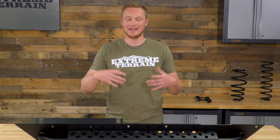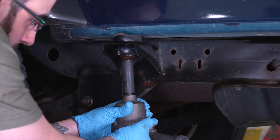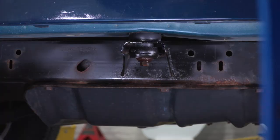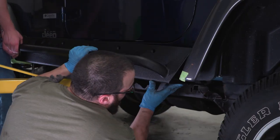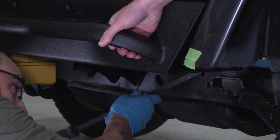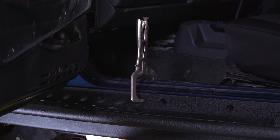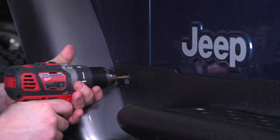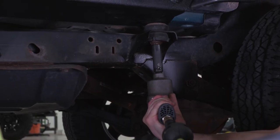The first step in the installation is getting rid of any other side step or rocker armor that you might have, and also removing those mini flares attached to the side of your Jeep. Then there are a couple of body bolts that you'll want to loosen up — be careful with this if you have an older TJ that you haven't removed the body bolts from before. You can spray the top of the body bolts and the thread area with a penetrating oil to get them loosened up. Then you can slide the bottom plate into position underneath the body bolts, between the tub and the frame where it's going to sit, and that's going to index the rest of your rocker for you. Use a jack or jack stands to hold everything exactly where you want it before marking the holes. Once the holes are marked, drill a smaller pilot hole, then drill out to the full size necessary — making sure on the inside of the Jeep you don't have anything that you're going to drill into. Use the included nut and bolt hardware to attach it to the tub, as well as tightening down your body bolts. Once everything is in position, this thing is going to give you very, very solid protection.